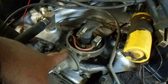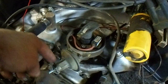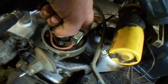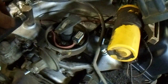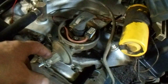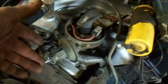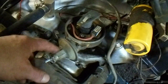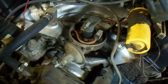So I suspected there was a problem with the vacuum advance canister. This right here is the vacuum advance canister. The basic concept is that as vacuum is applied to it, it will pull this mechanism over to advance the timing to whatever preset degrees you have — either a preset vacuum advance diaphragm or an adjustable one. In this case it's your standard non-adjustable factory style, but it wasn't working.